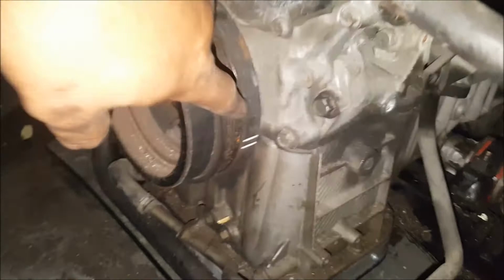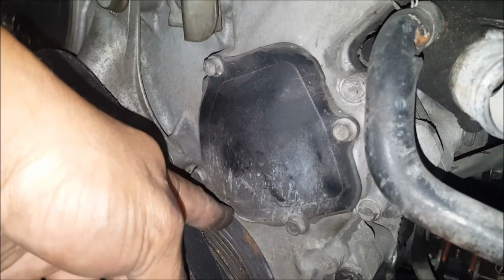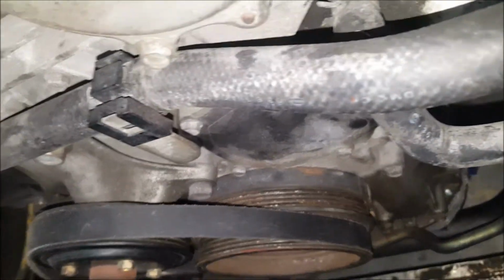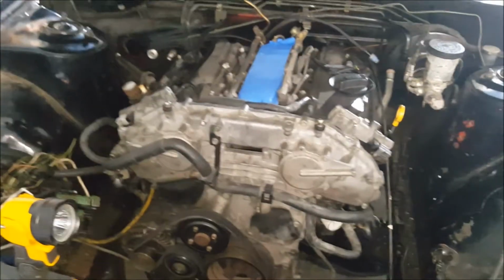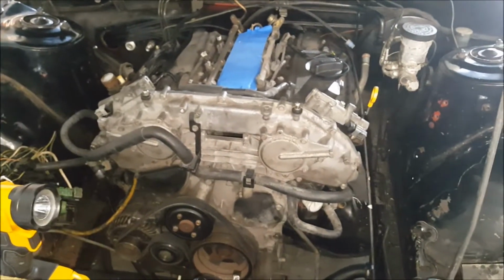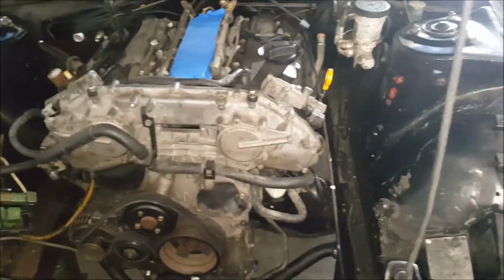And then I'll need to see. So these look like the crank timing markings, and I'm guessing this is the lineup that you need to hit it with. So once you shoot the gun like this, you'll look. It's kind of hard to see. I believe that's it, but that's going to be simple. And then just play with the trigger offset angle in the ECU to sync it. So that's what's up. All right, guys.